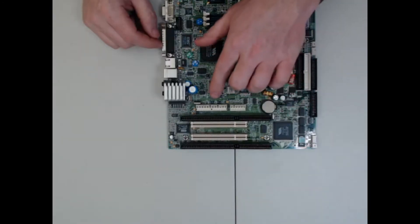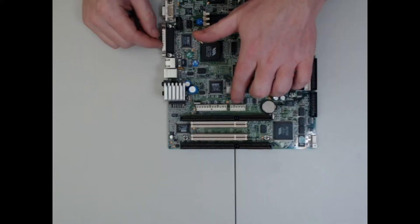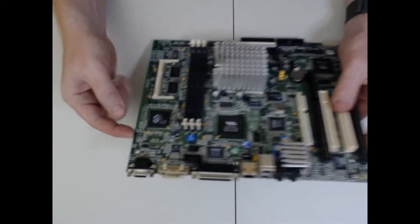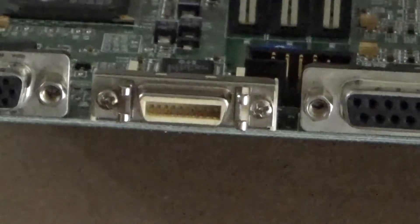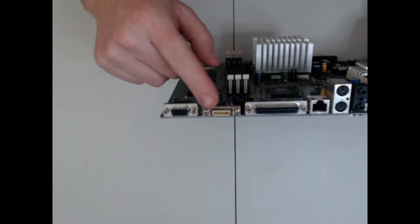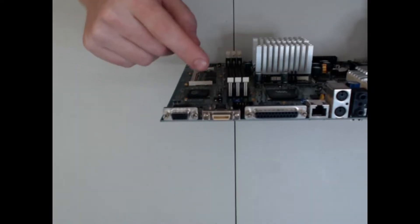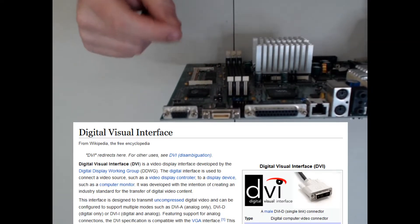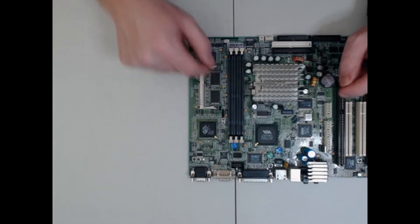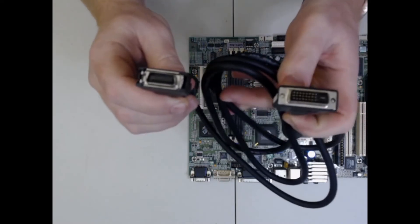The board requires an AT power supply with a third connector that provides an additional 3.3V in order for the board to meet PCI standards. From my unboxing video, I pointed out an unfamiliar port and assumed it was for a touchscreen display, such as what you'd find at a cash register or point of sale location. It turns out this port is a VESA digital flat panel, or DFP interface — a successor to VGA and a failed alternative to DVI. You can find adapter cables that allow you to connect this PC to a monitor with a DVI port using this DFP connection.